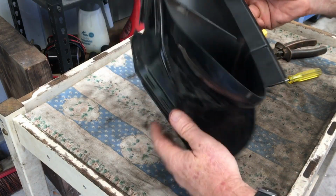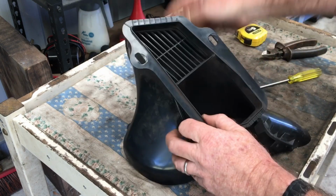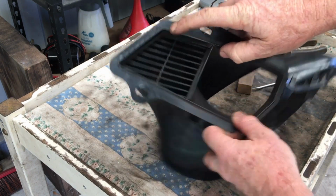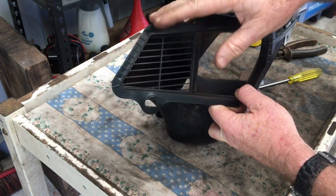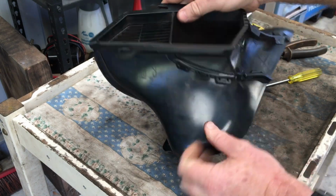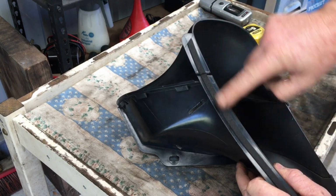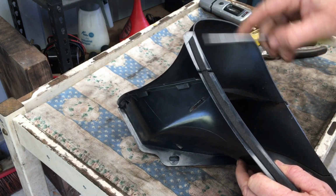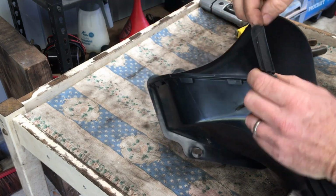Once you remove the intake, the way this fits together, there's a number of bits that all slot together, and this bit here, which is the one that goes into the engine intake, that's just a separate piece that just pops straight out. So we just need to open this up, not a whole bunch. And the way we're going to do that is there's a piece of foam along here, initially just cut along there, and then we're going to use a screwdriver and just pop open these 3 clips there.